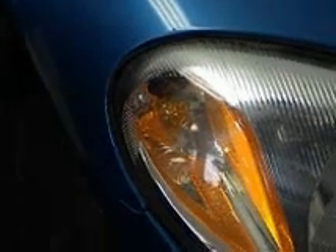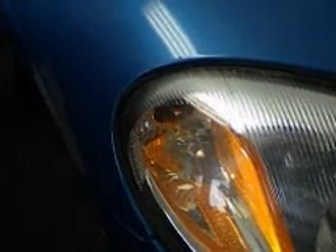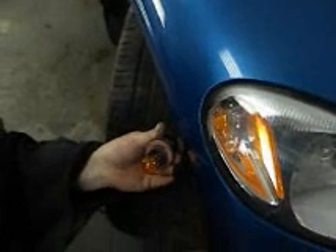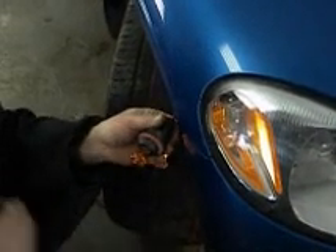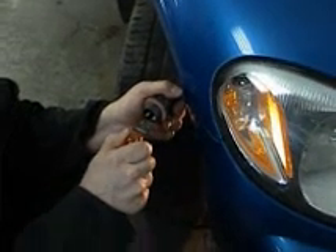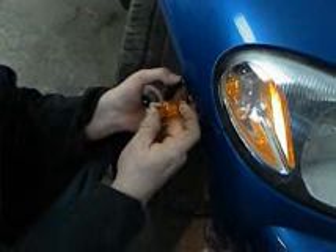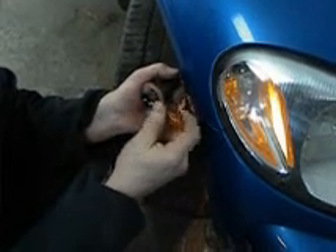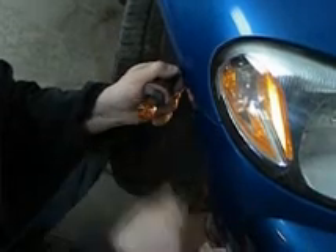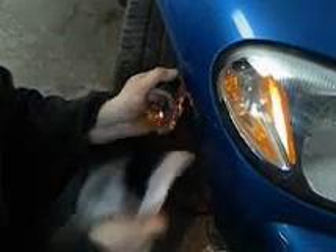Let's take a look at our signal light bulb. Support it from the back, turning counter-clockwise, and gently wiggling it out. This signal light is an amber click-in style. Grab hold of the signal light bulb and gently rock it out. This bulb is a 4157 bulb, amber, double filament — and it's good as well. So let's go ahead and click it back in and reinstall our signal light. Always remember to clean the bulb off first and reinstall.